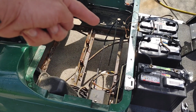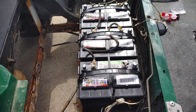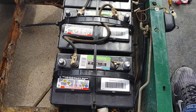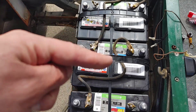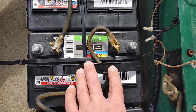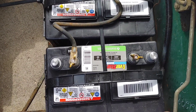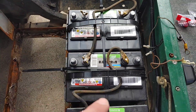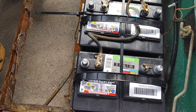To make these batteries fit in the cart, I'm using heavy-duty black zip ties. I'm using 24-inch zip ties — I've had to use three of them to make one big loop around all three batteries this way. Then I individually use two zip ties to make a loop around each individual battery. It looks nice and clean. I haven't tightened them down yet — I've got two going one way per battery and three going around all of them.